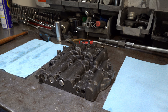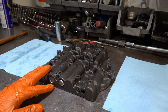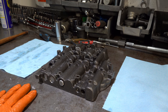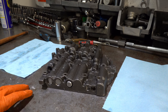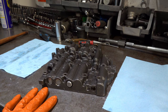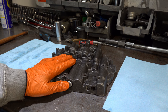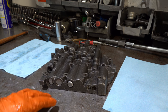Welcome back. Today we're going to be disassembling a 700R4 valve body. This is out of a 1992 unit, so it's 87 and up, which means it's designed to work with an auxiliary valve body. You can identify this particular vintage valve body by looking over here where the torque converter clutch mechanical valve train was installed in the earlier versions. It was eliminated starting in late 87, so you won't have the little port here — this will just be cast over.